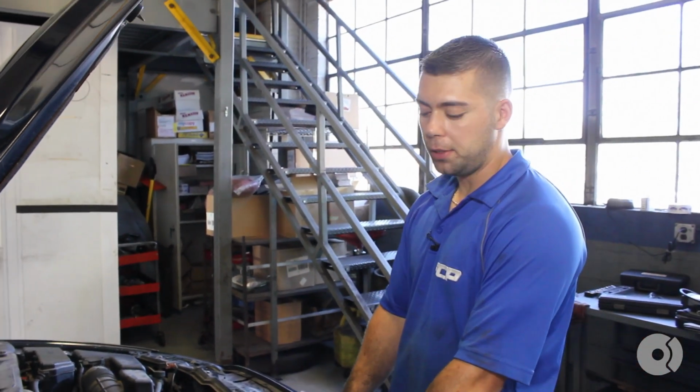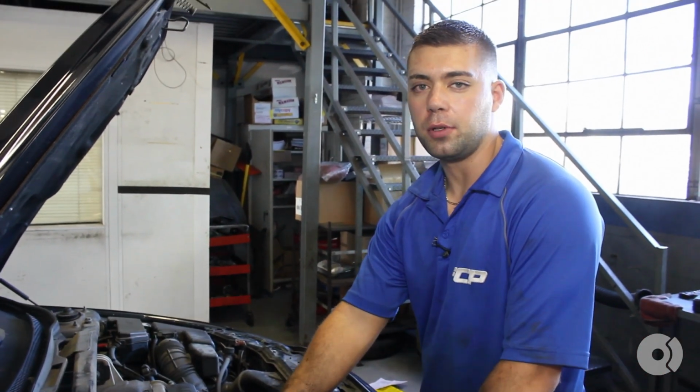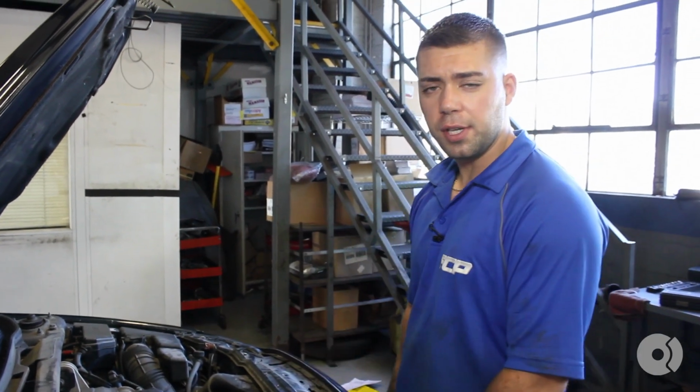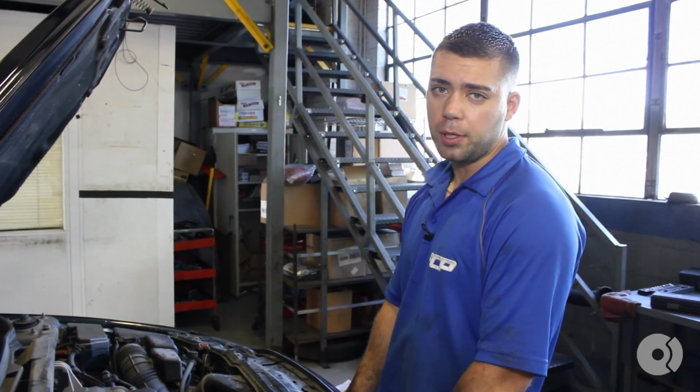All right guys, that about wraps it up. Just make sure your fluid level is topped off. Start the car, turn the wheel side to side, check your level one more time, take it for a test drive, make sure the level's good, and that wraps it up.